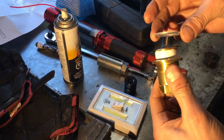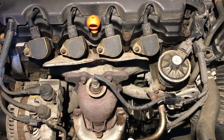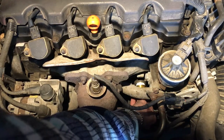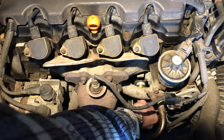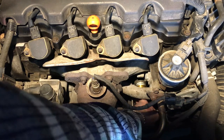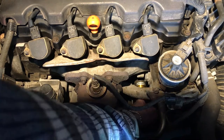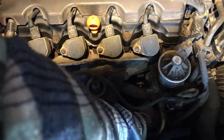This part came with a little washer — put that on. I've got the Teflon tape and the washer on. I'm going to carefully screw it into place. I want to make sure that I have the threads lined up so I don't wreck the threads. I'll give it a little shake to make sure the threads are correctly lined up — feels good. I'm going to do as much by hand as I can.